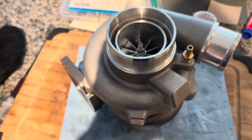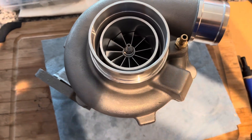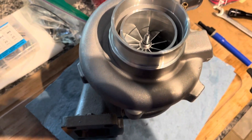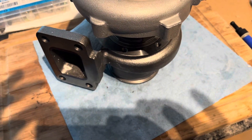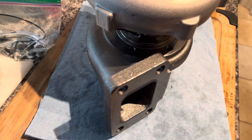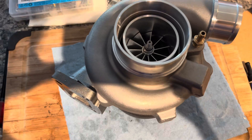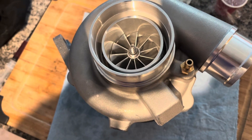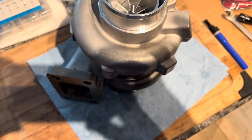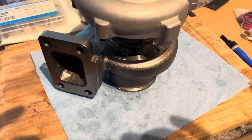This was advertised as a 55-60 T3/T4, but I could tell looking at the housings it's got Gen 2 style housings. Based on that one dimension, which was supposed to be the same on compressor and turbine, it's a GT30 size turbo. When we pull it apart, we may have an opportunity to replace the bearings with upgrade bearings through 360 thrust. It's an 11-blade billet front end and a 10-blade GT30 — 55 exducer, 60 inducer turbine on a 0.64 T3 housing.